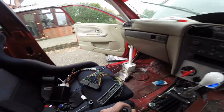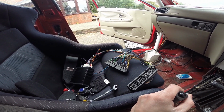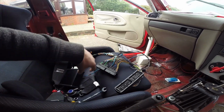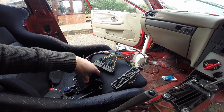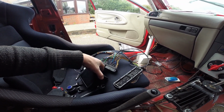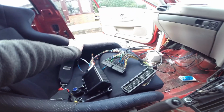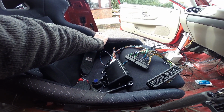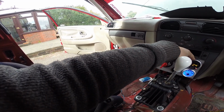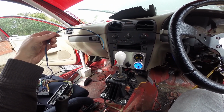If I did have the coil harness all ready to go, then we could probably give it a test fire, but I'm going to get this in place, plug it in, make sure that all the sensors are working, throttle position sensor, coolant temperature sensor, and so on and so forth. I've already mapped in the parameters of this engine, the size of injectors, the dwell times on the R8 coils, things like that. That's all been programmed into this. Then it's basically give it a test fire and see how it goes. So what I've got to do is cut that bolt off, get the grinder out, and then plug this in, power it on, see if it works, and then start calibrating all the sensors. Also, what I have to do is wire this into the wideband, because it will take wideband signals off of that, and that will serve for my O2 correction.